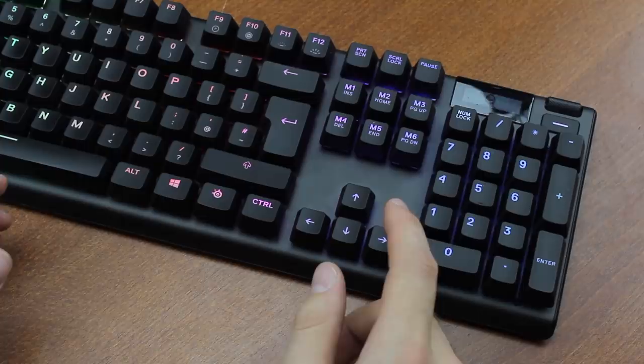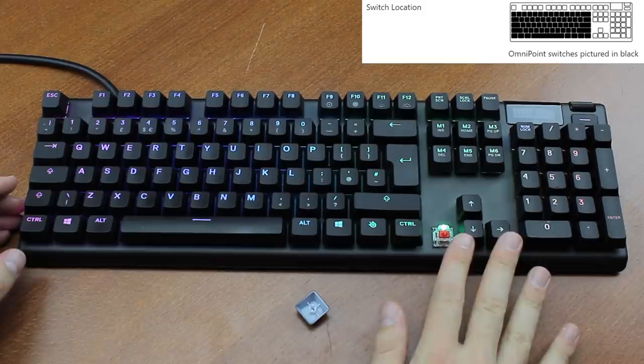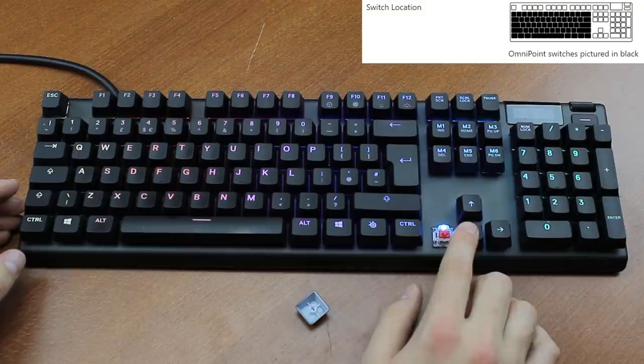See, the whole alphanumeric area is, but the F keys, nav cluster and numpad aren't. They're basically Gateron Reds made with custom molds and inspected by their own QC staff. By the way, Gateron also manufactured the Hall effect switches, but not the sensing assembly, which is held PCB side. The red switches are simple contact-based switches and aren't capable of analog output or actuation adjustment though.